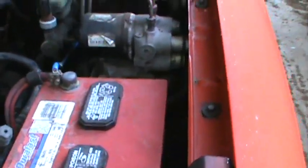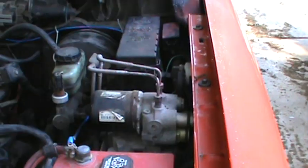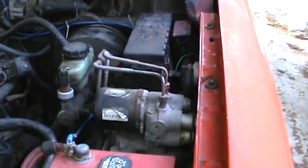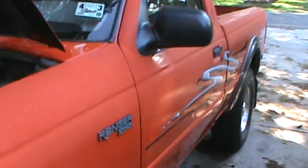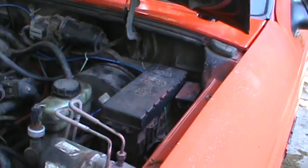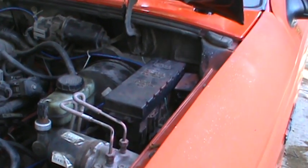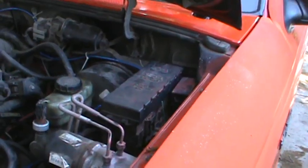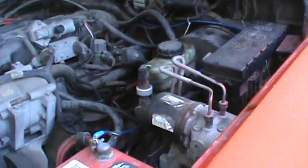It really wasn't an expensive fix, but it was a very time-consuming and very frustrating fix, because I crawled all the way up under this thing, all the way to the fuel pump, and tracked wires all the way up under the dash, until I finally found a broken wire underneath that spade connector. It would make contact if you pressed in just right and wiggled the box a little bit, and you could start the car.